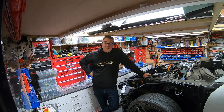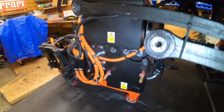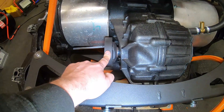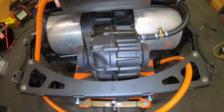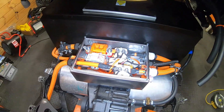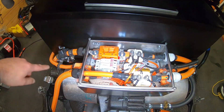The last time you saw this LDU setup it was a lot less busy, but now it's basically ready to go into the car. Starting from the back: on the LDU I've got the driveshaft stumps in here — these are Model 3 splines welded to the Boxster driveshaft fitting, so you just bolt the Boxster driveshaft straight up. The high voltage junction box has had some more modifications — I've had to put in some extra bits, namely fuses for things like the charger, DC-DC, and the aircon.